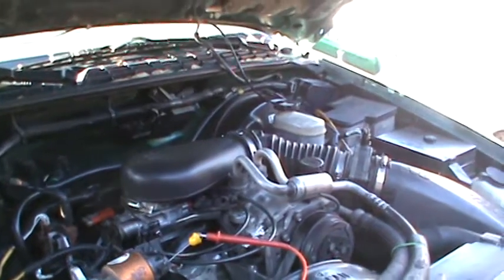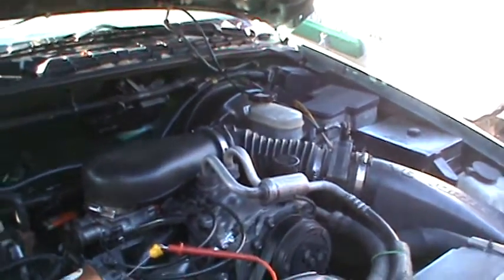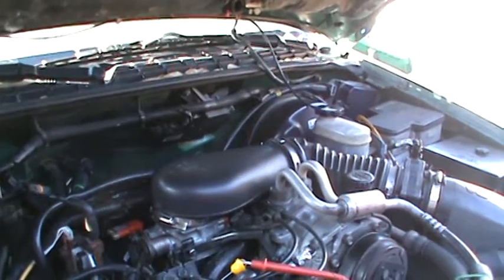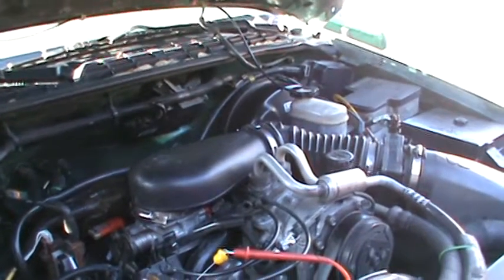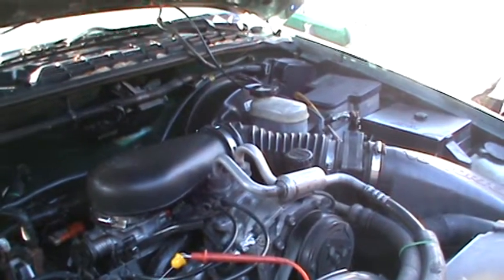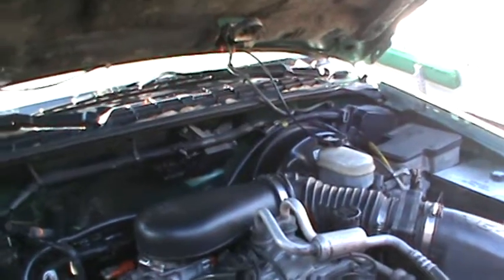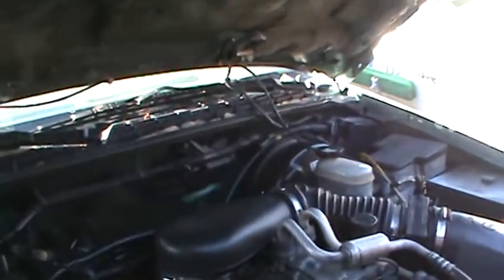It's not going to cause a random multiple misfire, because the thing is running so lean. And again, if you hook the scan tool up to this thing and look at the fuel trim, it's positive 10, positive 15 at idle when you first start it up, and that's bad. It should be negative, in the negative 10, 15 range, until it goes into closed loop.